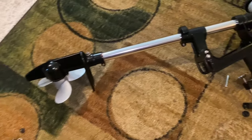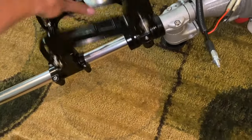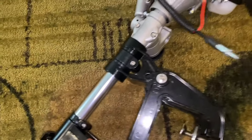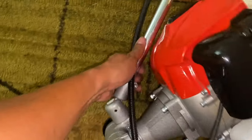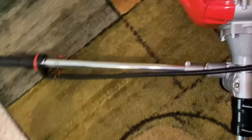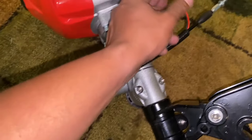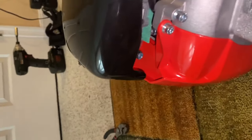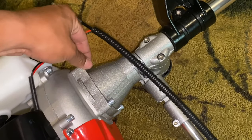The assembly was pretty easy to figure out. It came almost fully pre-assembled. You do have to install the bracket — the permanent-style one swings on and off when you turn it around. You mount the controller directly on the swivel point, and there's an on/off switch. The wiring harness is just red to red, black to black. The more complicated part is you have to manually hook up the throttle cable to the throttle body, which I'll show you how to do in a minute.